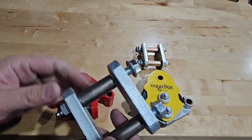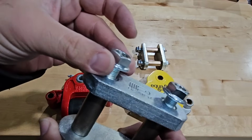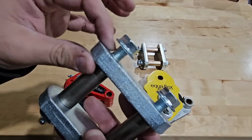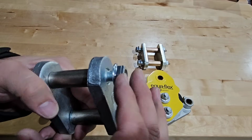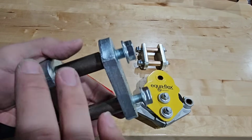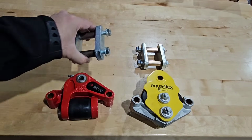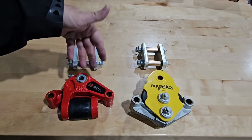One thing that both brands do, these are Dexter and these are Moride, is that they pinch the ends right here, so whenever you tighten these down, it's more of an oval shape at the end, and they actually kind of self-tighten themselves and fasten to the threads whenever they get fully seated, which is pretty cool. You're going to wonder why when you start to tighten these things down, they lock in place, and because of that, if you ever have to remove these, you pretty much have to replace the whole setup, at least the bolts, because you might end up stripping out the actual threads at the end. But both Dexter as well as Moride as well as Lippert with their system all do it as well.